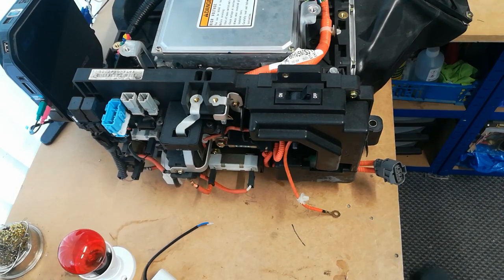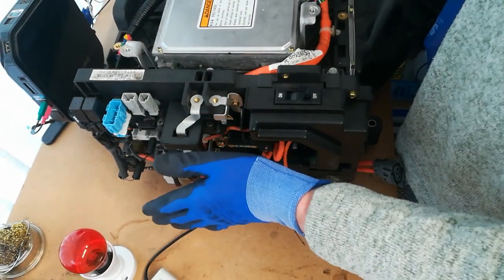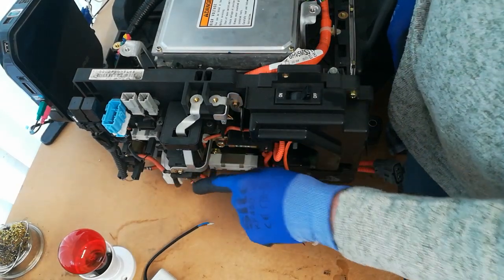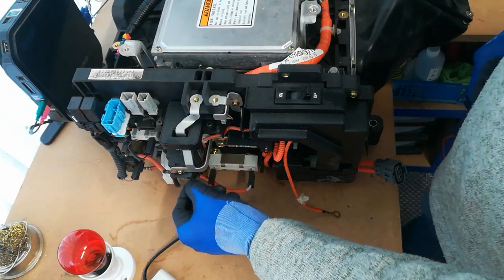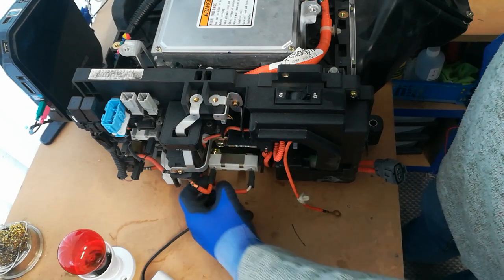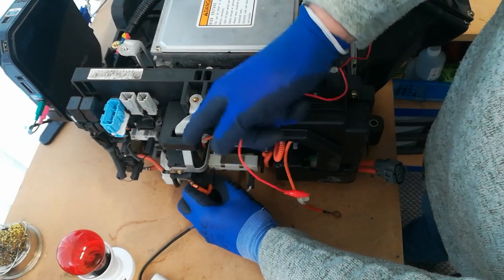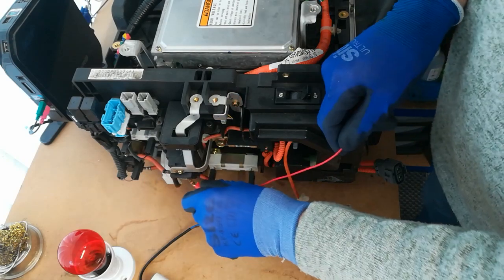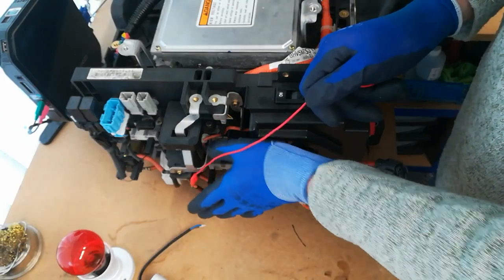This is the end of an IMA battery. Imagine this is the back of the car at this end. You have to squeeze your hand down between the DC-to-DC converter and the end of the switchboard — make sure it's turned off. This is the connector for the positive: it's just a little piece of exposed metal. You can use a standard quarter-inch spade terminal adapter, or if using crocodile clips, just clip one onto an exposed bit of metal there — that's your positive connection. The only difficulty is getting your hand down there, so make sure you've got your gloves on.